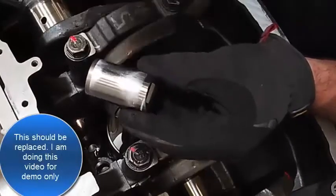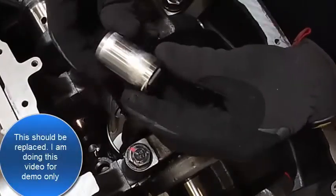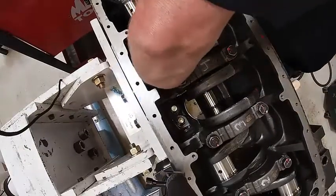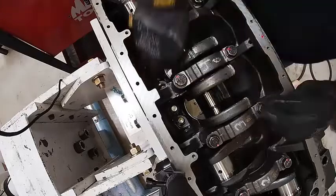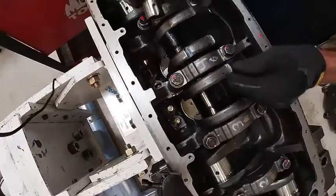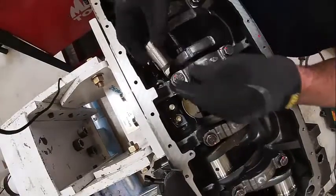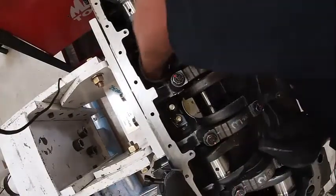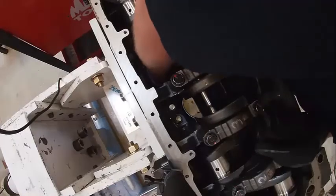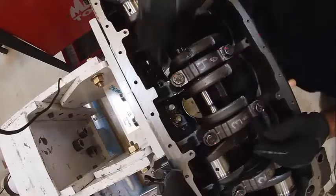There's some spalling on that — scarring. Didn't have enough lube in it. I've dumped some oil down in here. You may have to get a magnet or something. There's intake — same thing, it's got some spalling on it. This is one of those things: when you change the camshaft, you change the lifters. They're a match set.